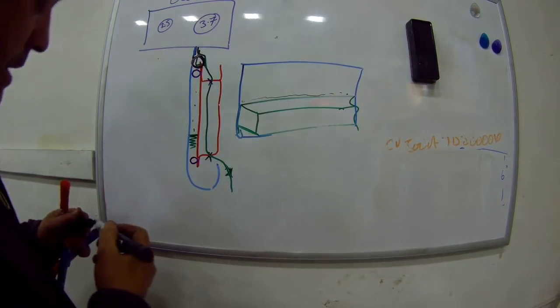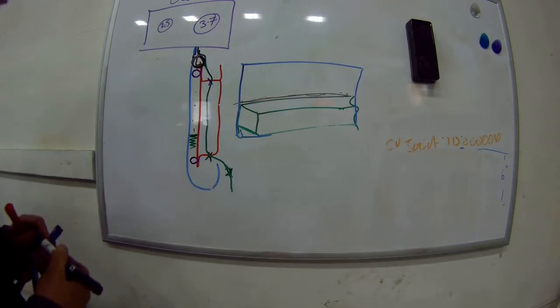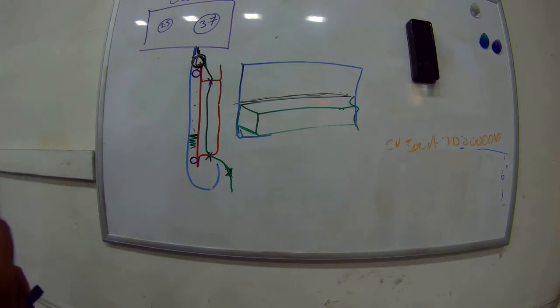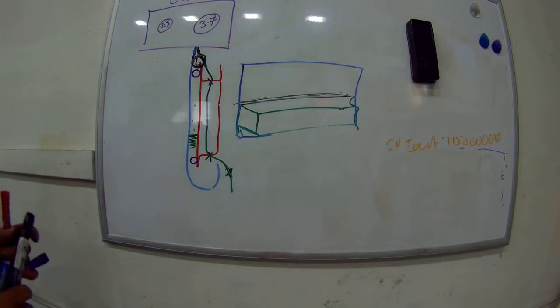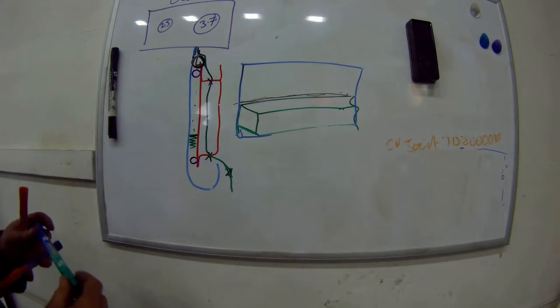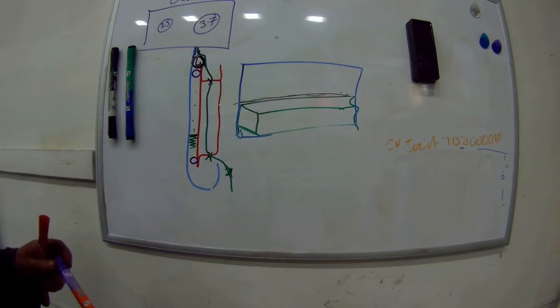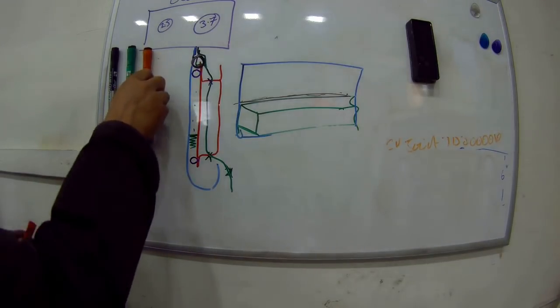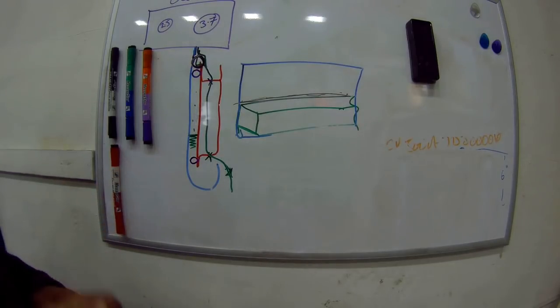It also helps if you put a lot of anti-corrosive stuff in. I don't recommend wax oil. Now that's going to sound really bizarre coming from a Brit, as wax oil is supposed to be the best thing ever. It's actually rubbish. Because it hardens, in Canada it hardens to such a point it can crack and then water can get behind it. So it's just like a lot of rust proofings.